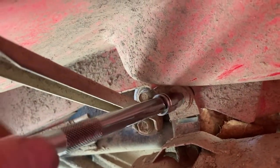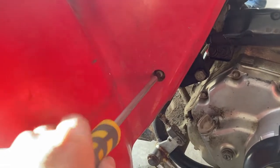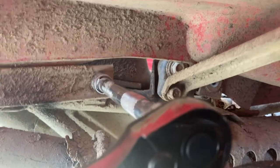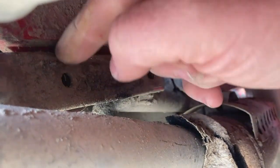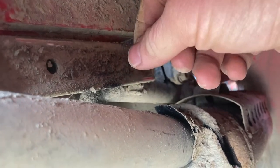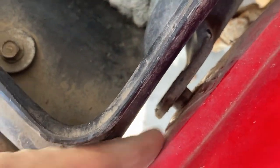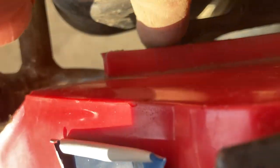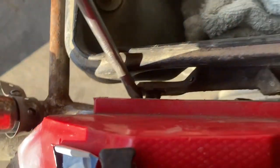This bolt is kind of hidden near the brace. Back by the bumper, the fender is pinched as it goes in between the bumper bracket and the frame of the ATC. At the rear part of the fender there's a hole, and part of the frame has a round piece that the fender comes over. Using a small pry bar in there, you can create clearance to pull the fender off without removing the rack.